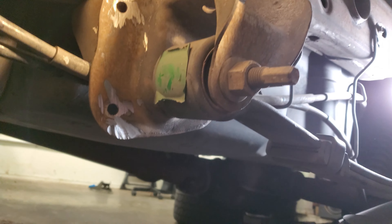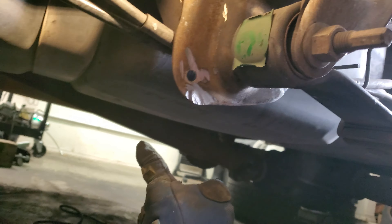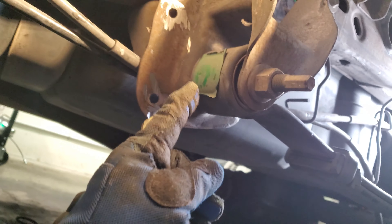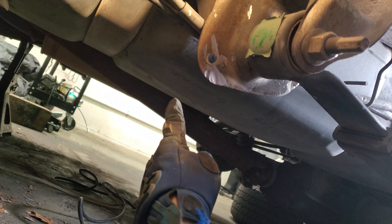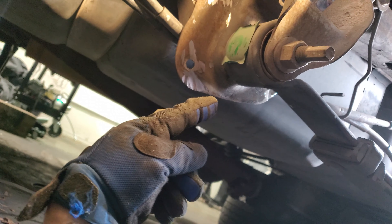This is what I wanted to show y'all. As you can see, we got all the rivets loose and dropped this down enough — with the bolts right here — where we can swing it straight out without having to take the tank out. We'll do the same as the other side: put the bracket on and pump it back up. You don't have to take the gas tank out on this, so don't let that scare you. Just drop it down a little more, take this bolt out, knock the rivets out with a hammer, run the bolts in, and we're ready to put the wheels back on. It ain't too bad once you get all set up.